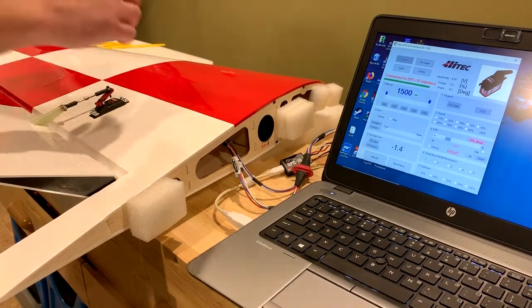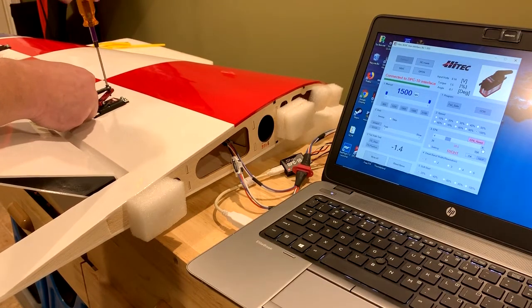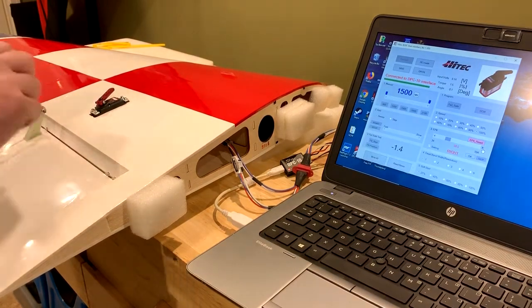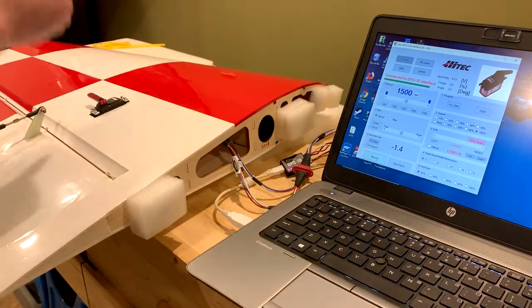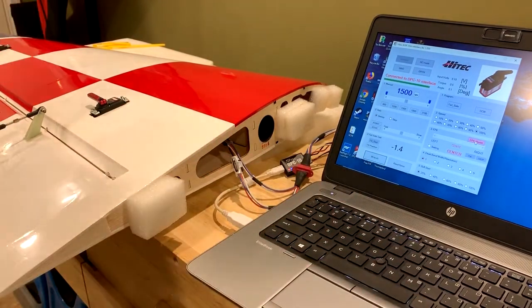So, one last time, we will unhook this, because when we hit OK, it's going to swipe down the center. Go here and say okay, completed. Now it's important, you'll see that go back to center. You always have to hit write all, because right now it's all kind of in memory, it's not actually written to the servo. You have to hit write all, completed, and now the servo is completely programmed, and we'll go on to the next step, which is programming the outboard servo.